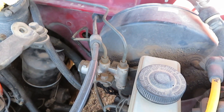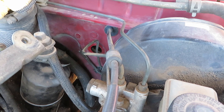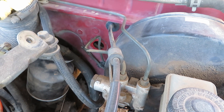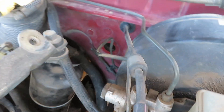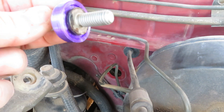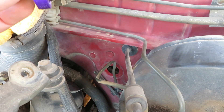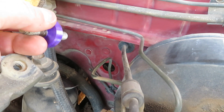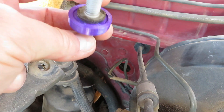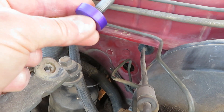A lot of people run the battery cable back by the clutch master and route it along the frame rail by the steering shaft, but I really don't like that — then it's one super long cord. My speedo cable broke almost instantly within 100 miles, so this could work with or without a speedo cable. I 3D printed a pass-through — it's basically just a bolt. It's a 24.5mm hole, and there are other options if you want to enlarge the hole. I might revise this design later with some brass, but for now it'll work perfectly fine.